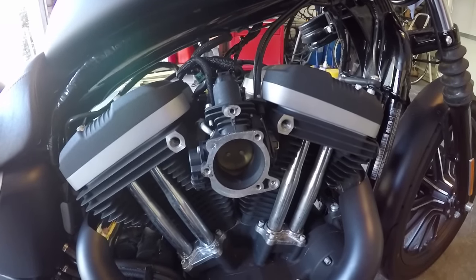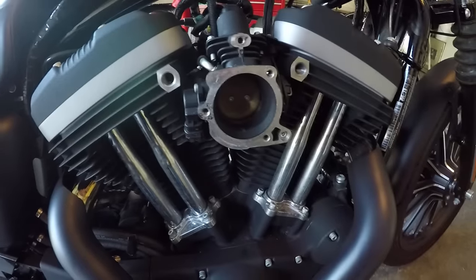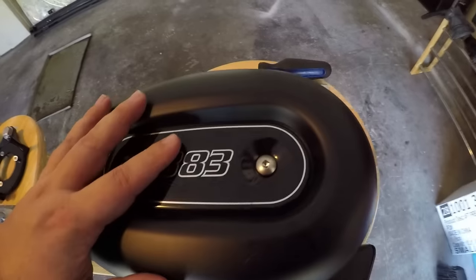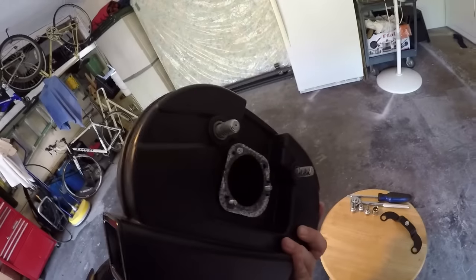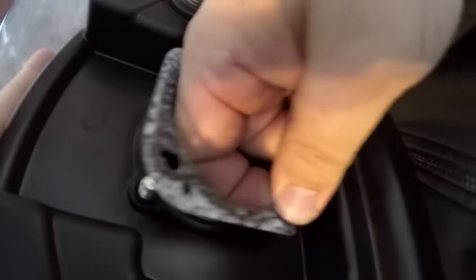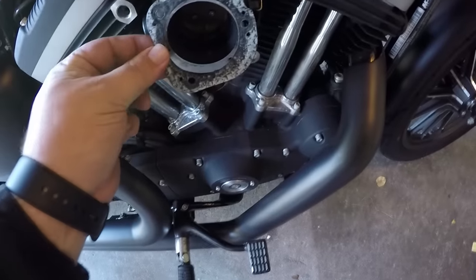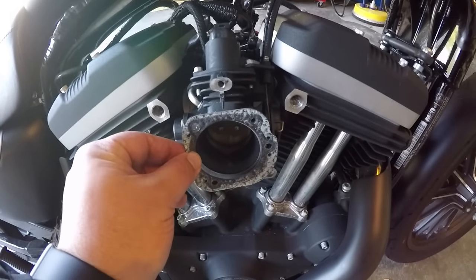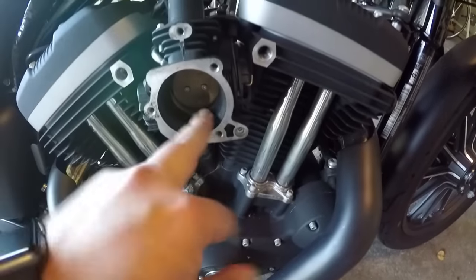Pretty simple stuff. Go ahead and clean up all this area — there'll probably be some oil, some blow-by in there, so clean all that up. I put the stock air cleaner back together like this so you can keep it all in one piece. You will need this little gasket piece right here — take that off your new air cleaner, as it might come with one. If not, it's nice to have. Don't rip it — it's basically a gasket that goes between the throttle body and the air cleaner so no air seeps in. Get it all cleaned up, wiped down, oil cleaned up, and you're ready to install the new air cleaner.